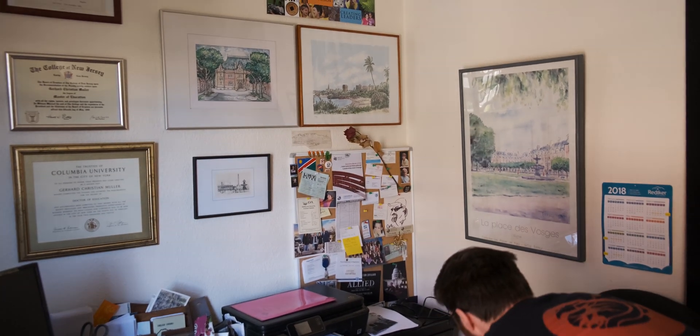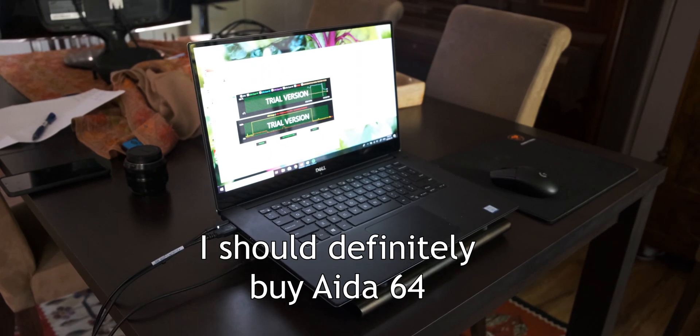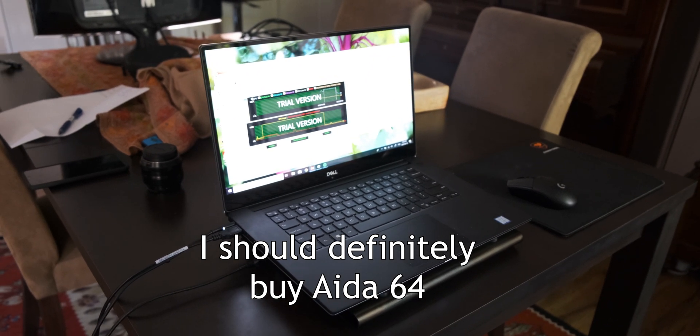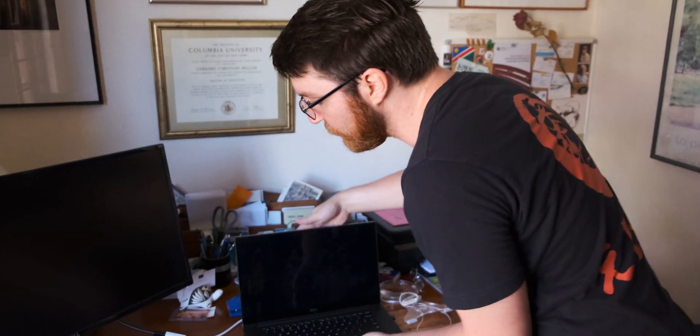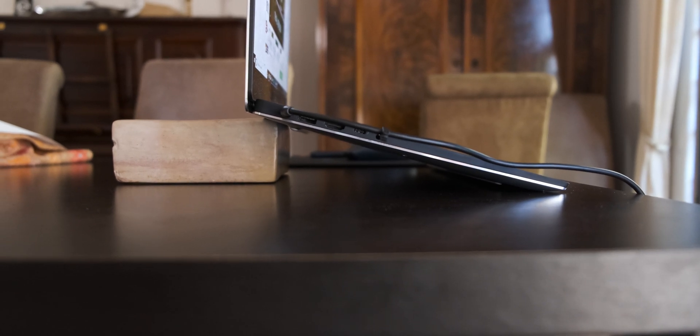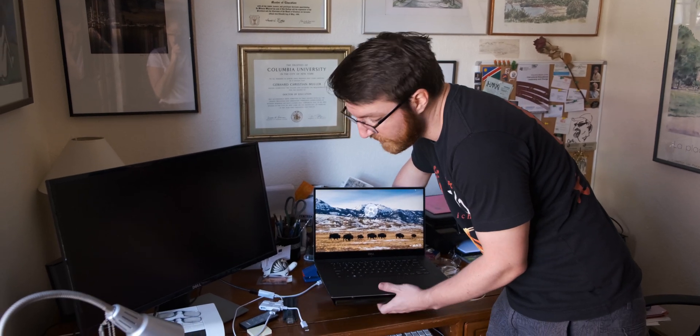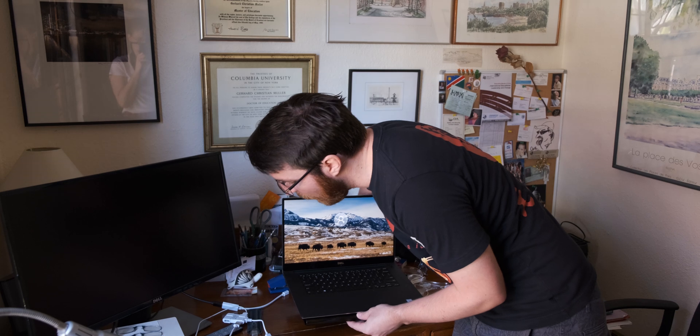There is some air coming through and it is really cooling, especially since it's really hot in this room. I'm going to test it in four configurations: first with the laptop flat on a table, then running AIDA64 for 20 minutes to see if it throttles thermally. Next I'll put something under the laptop to elevate it off the table without the stand, then one test with the stand flat on the table, and finally a fourth test lifting the whole stand off the table to see how much breathing room underneath matters.